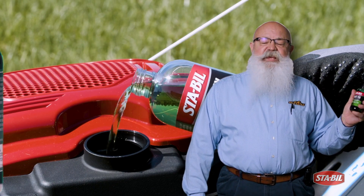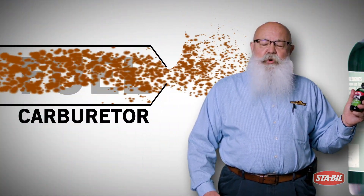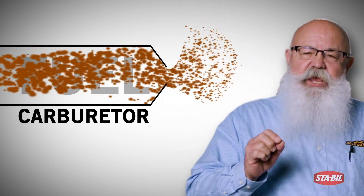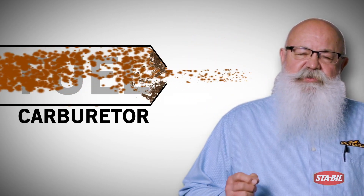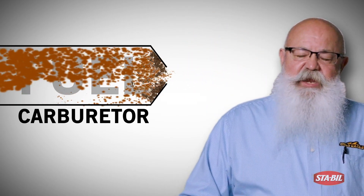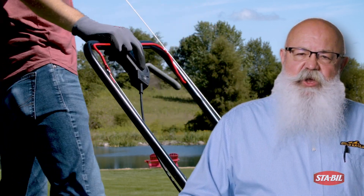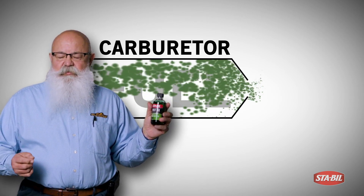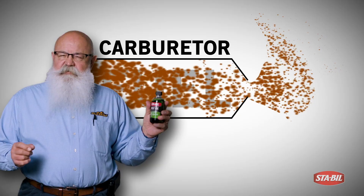Once you pour Fast Fix into the fuel, the fuel will be pulled through the carburetor. There's a small little triangular point, and if there's any dirt or particulate matter and the fuel is not passing clearly through that opening, the engine will stall and sputter. This particular formulation will actually help dissolve that particulate or deposit, which is similar to varnish — like the thin brown layer of varnish you see on painted wood. That is what gets dissolved as the fuel is being fed into the carburetor.